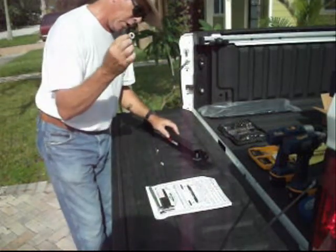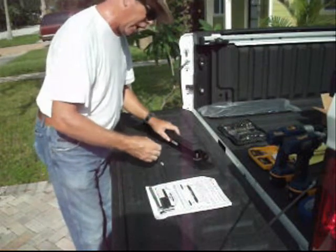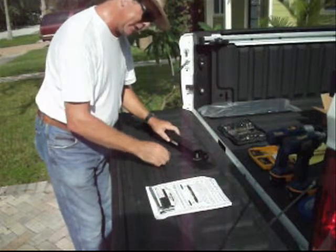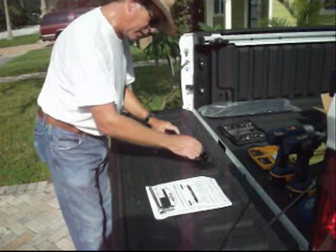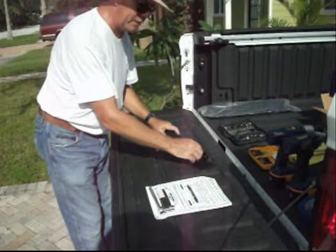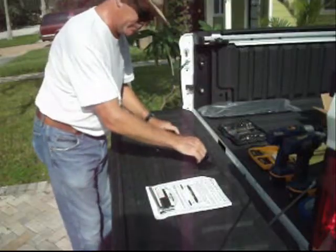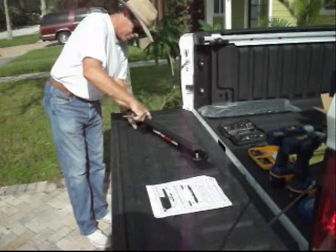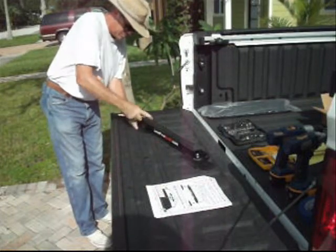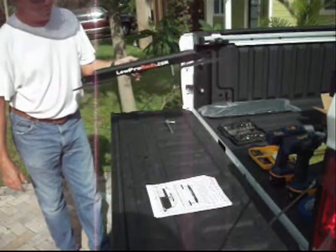Then place the flat metal washer onto the bolt on each end, and then install the lock nuts and tighten them gently. Snug the rail to the feet. Now these lock nuts are going to be coming off again before we permanently mount the roof rack onto the roof. Okay, now we've got this unit here as one assembled unit.